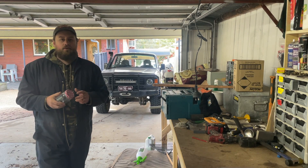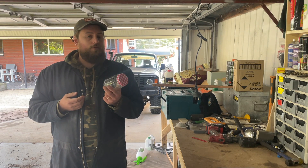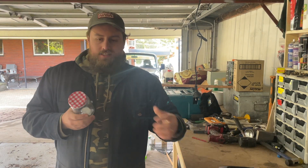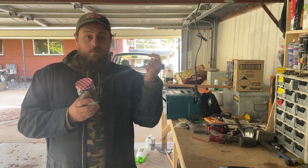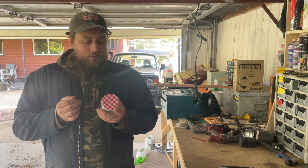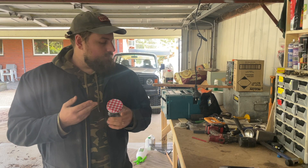G'day, welcome back to the channel. Today I'm going to be building a DIY smoker vacuum tester. Basically it's a hose and a mason jar filled with mineral oil, and we'll be able to pump smoke into it and see if my exhaust has any leaks. I found a couple but I'm still having trouble with the car, so — very simple, let's do it.